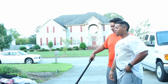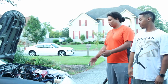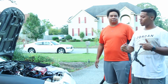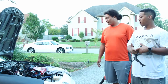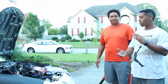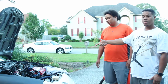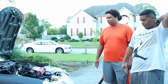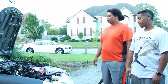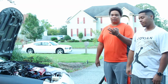Anyways, what we're gonna do is put the Moroso oil pan on my GSR. Got to change the studs first. We got a stud extractor, so it should be fairly quick. We got to make sure there's enough clearance between the oil pan and the oil pickup tube so I can feed enough oil into the head. It should. My OEM oil pan dented up, so it's not receiving oil pressure. So I got to put a windage tray on and the new oil pan.